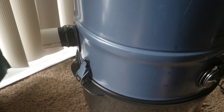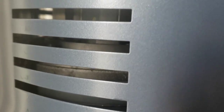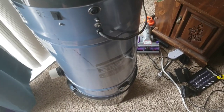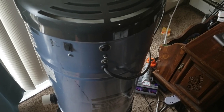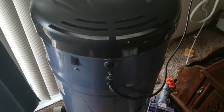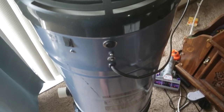That does have a fitting on it that's meant to attach to a piece of central vacuum line. I replaced the foam — there's actually no foam inside this motor compartment, which is kind of strange. It was suggested it might be due to heat issues, but I replaced the foam under the dome here, and then there were circles of foam around the motor's cooling fans. The foam had just gotten so brittle it was crumbling, so I got that fixed. I also changed the front motor bearings and cleaned the motor fans, because they were very dirty. The front bearings weren't horrible, but bad enough that I decided to change them. And once I got into the motors, I discovered I didn't have that bearing size, so I had to order some new bearings.